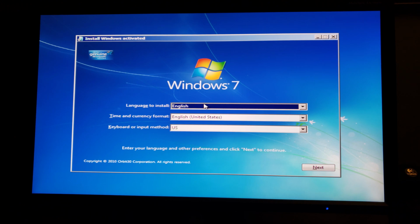One of them is using just the modified USB Windows 7 installation thumb drive using the Gigabyte tool that I mentioned in that video. Basically, it injects some USB 3 drivers in there, along with some other stuff, including NVMe support. So obviously you'll be able to use, let's say, your USB mouse, which obviously is not working here, but I do have a PS2 plugged in. So that definitely does make things a little easier.